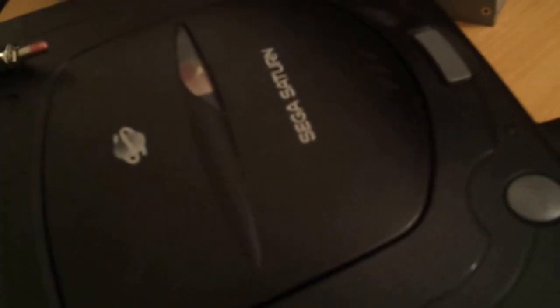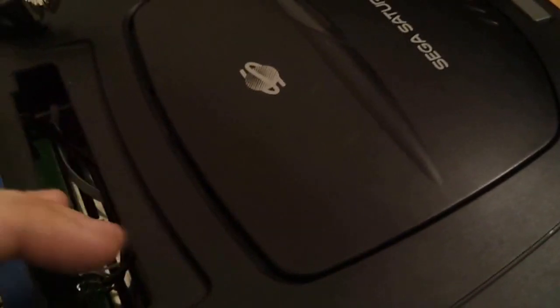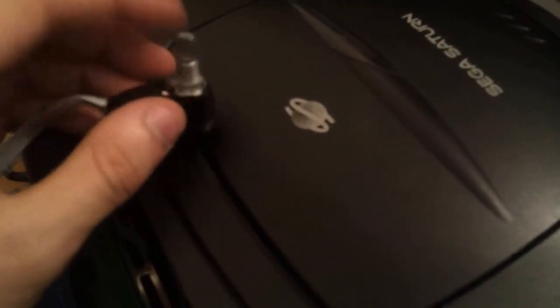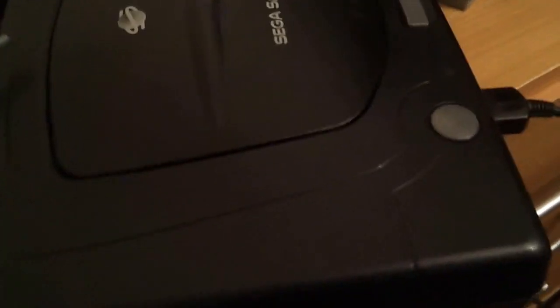The sound is actually amplified, so you don't need a separate amplifier — you can plug this in and it will work perfectly. There is a slight issue with the sound, a little bit of crackling or popping, but it's not so noticeable now the case is closed. It's got RGBS output so it will work on any monitor. There's also a volume pot which will adjust the sound output volume — this is stereo, and wired to Midway standard, so pin 10 is your left and pin 11 is your right.